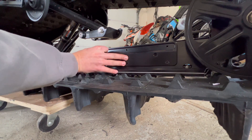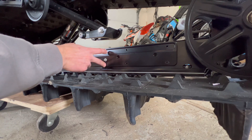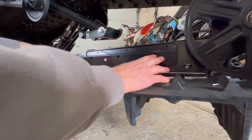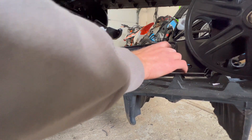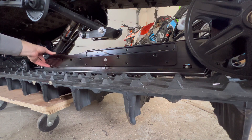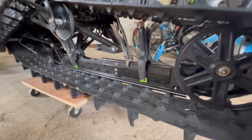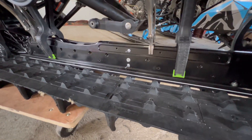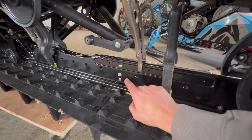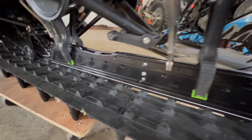That's where we're gonna put our rivets on each side. You want to get it as straight as you can with these rivets, then fasten those two rivets — that'll put our brace in place. Then we'll drill out all the rest of our holes and continue riveting. We got our brace in place, used our through bolt to line everything up, and we got our two rivets set.